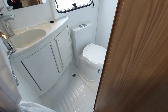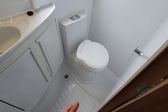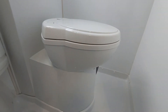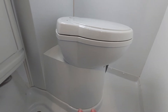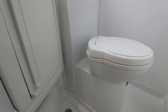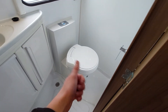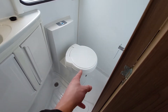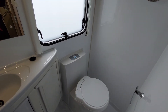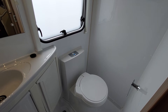Moving to the toilet area — to use the cassette toilet, turn the blade away from you like so, and that will open the cassette toilet allowing waste to drop into the cassette. Once done, click the blue button on top of the toilet to flush the system. Then pull the blade back towards you to close it — you close the blade to stop odours escaping when not in use, and to get into the habit of having it closed so every time you remove the cassette it won't jam. The blue flush button requires the pump to be on and it uses fresh water. A red light on top indicates when the cassette is full.